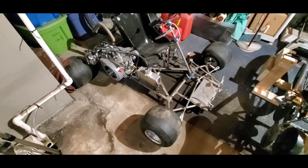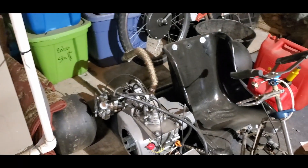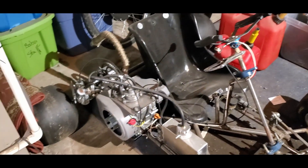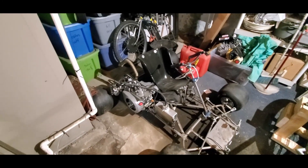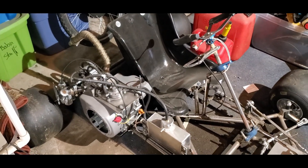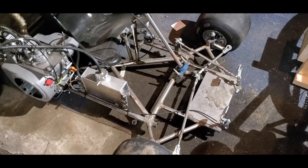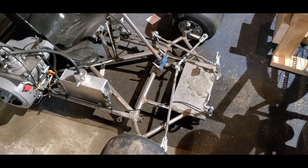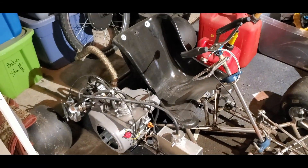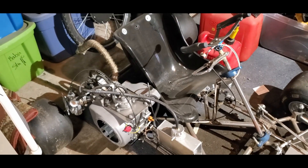Now we're down here in the basement. Here is the go-kart that the snowmobile engine is going on. Right now it has a built Predator 212 engine. My plan is to center the snowmobile engine on the rear of the go-kart, extend the frame, move the seat to the center, and relocate the steering wheel to the center. I'll redo the brakes and the fuel tank. I'm thinking about leaving the front configuration for now even though the pedals are un-centered — that won't be a problem as long as the steering wheel is centered. I'm going to cut off the rear and keep the same axle and axle hangers for now.